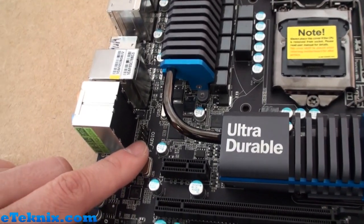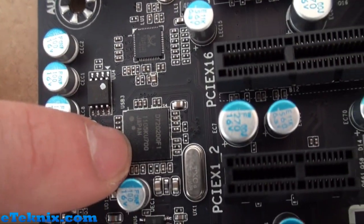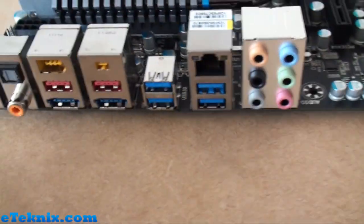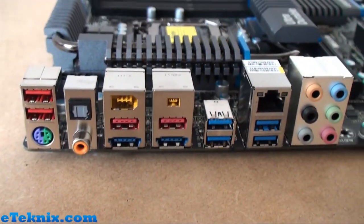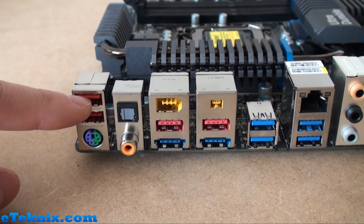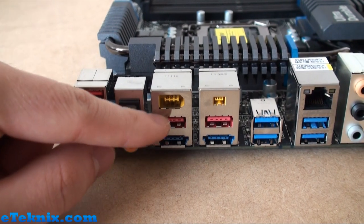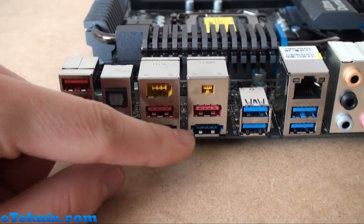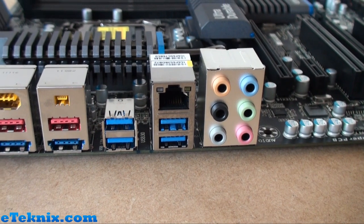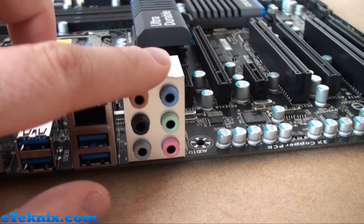Just up from there we've got front panel audio, and USB 3 with the NEC chip just here. There's a Realtek audio chip as well. Taking a look at the IO panel it's very bright and colourful, all colour coded. We've got a PS/2 combo mouse and keyboard port, two USB 2.0 ports — not blue so they are USB 2.0 — optical and coaxial digital audio, Firewire and a smaller style Firewire, more USB 2.0 ports, eSATA, four USB 3.0 ports in addition to the two headers on the front, single gigabit LAN — on the UD7 we believe there will be a second one for dual gigabit LAN — and then analog audio outputs.